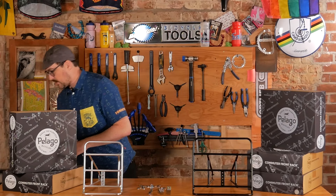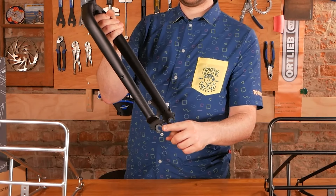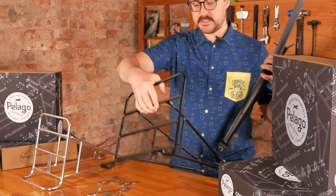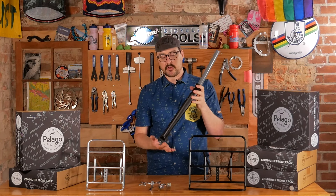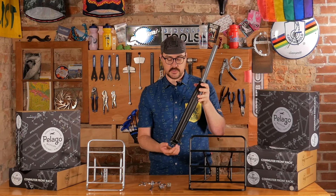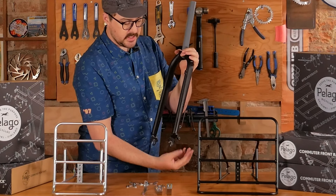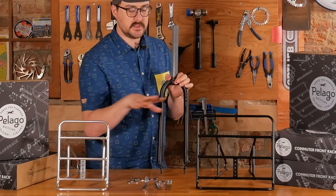As a secondary example, here's a more modern disc brake fork. You can see a disc brake mount, front and rear facing threaded eyelets, and mid eyelets. This rack doesn't require a mid eyelet, but you can install it right onto the front facing eyelet — that'll fit just fine. Ideally you want to use the front-facing eyelet; the rear-facing eyelet is intended for fenders and not necessarily load bearing. I would generally avoid it because I've seen these get sheared off when overloaded. With a disc brake fork, you also have a large tube to space around, and I would not assume that without a front-facing eyelet any of these would actually fit.